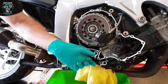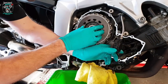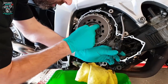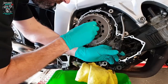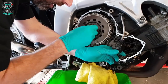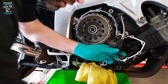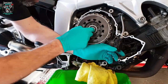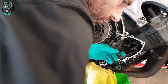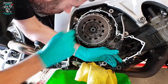It will become clear in a minute, but there's a diaphragm spring. It will make more sense as it comes apart. There's a ring of bolts here to undo. This is a push rod here which runs — it's got a pin on it which centres it in the gearbox shaft. Keeps it true in the centre of that bearing. So that can just be removed. That bearing may come out — sometimes they're a little bit tight, but it just drops in. We'll undo this ring of bolts and there's a nut in the centre.